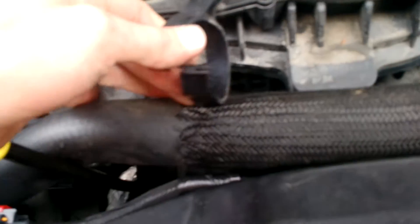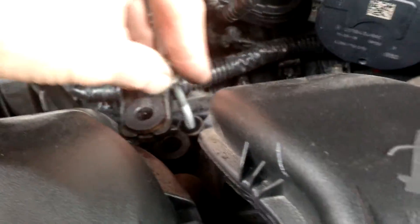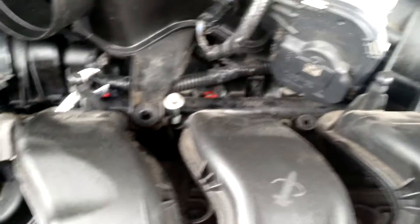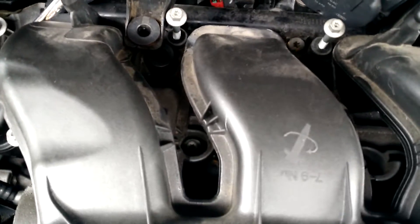So we've got that back together. You're going to reinsert the antifreeze line here — the coolant line back into this plastic clamp. This was a little tricky to get apart; I just used two really small flat heads and worked it away from each other. Before you tighten down the plastic air box, start with this — get that in. I do believe I'm missing one, and we will be good to go. Here's a better look: you can see the four standing up here. This one drops in, that one drops in, and you've got one hiding back here. Jump ahead a little bit before I snug everything down for real.